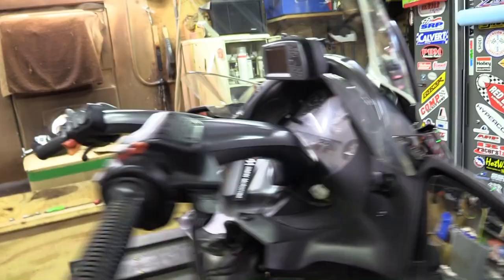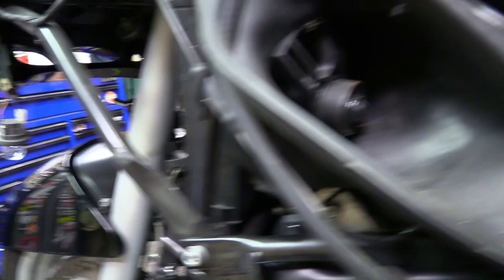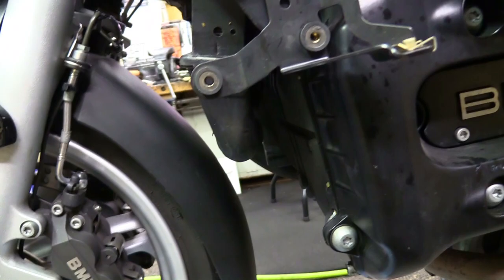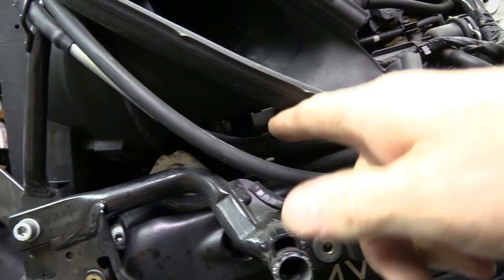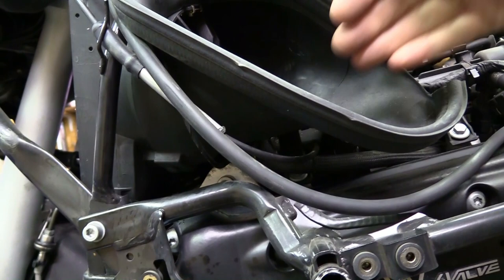Of course that micro switch can go bad, and if it does, really all you have to do is unplug it. You'll have to take the covers off and probably pull your gas tank off to get to it. You'll be able to see it — it's a little plug that looks just like the fan plug. If you pull this off, you're going to see where the fan is connected and then you're going to see another plug that looks very similar with a blue and a black wire attached to it.